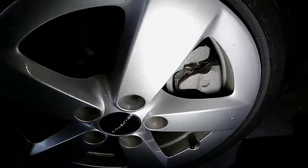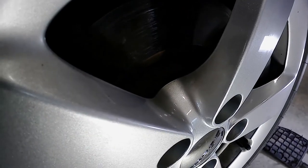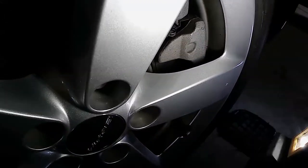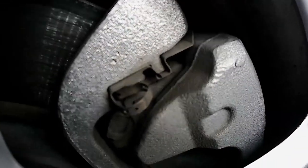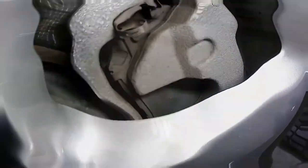All right, so I'm trying to gander at my brakes here. The rotor, I don't see gouges. I'm gonna just kind of run my fingernail through there. Nothing's grabbing. They look to be in good condition. I don't see any burn spots in it. What I'll do is probably just get the kit whenever I order it. All right, I'm looking at my brake pad in there. I can see it, and I'll see if I can get you to see it. I can see that there's pad left.